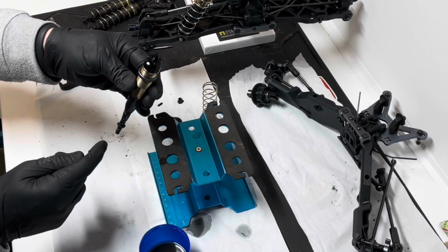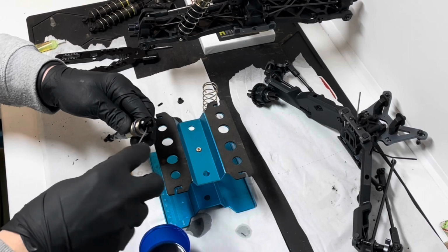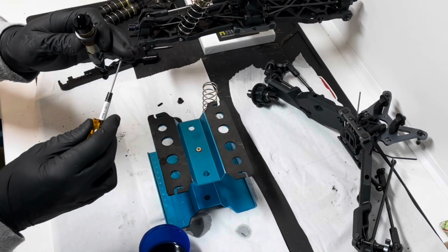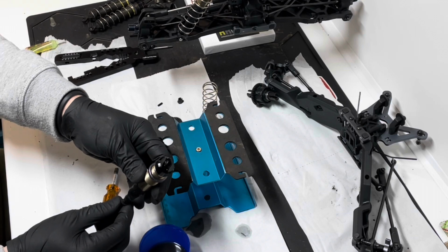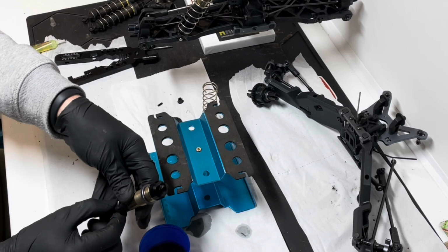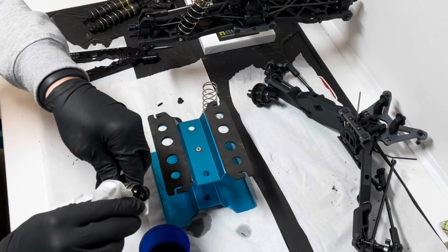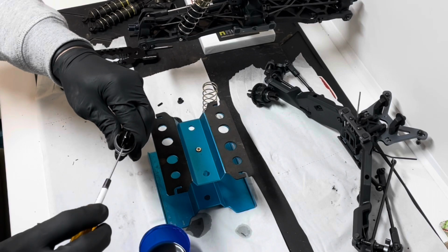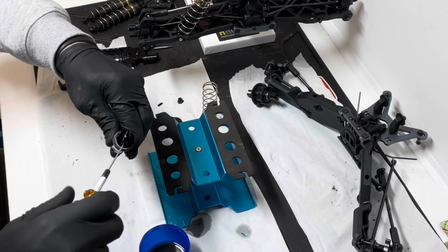And then we're going to leave that all the way down. Pop that bleeder screw back out. We'll leave it on the end of our driver, and then we're just going to slowly push back up again. Just get a little bit coming out the top. Clean bit of towel. Give that a wipe. And that's now emulsified. And then do your bleeder screw up.